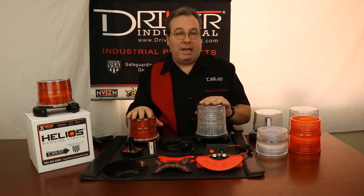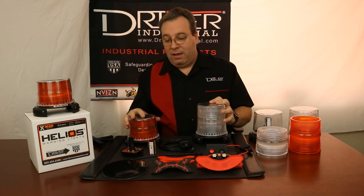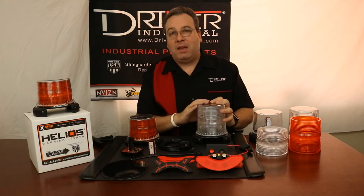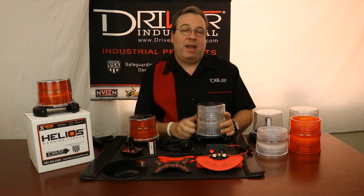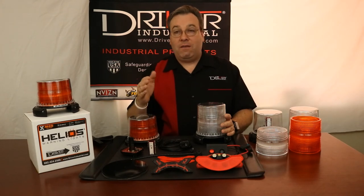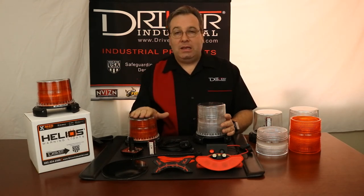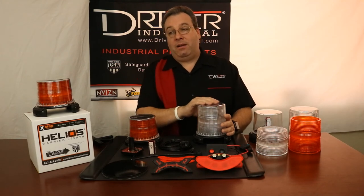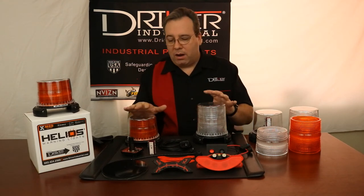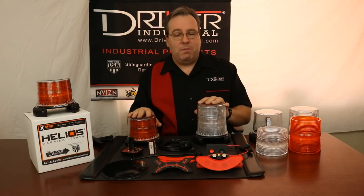If anything breaks or needs to be replaced, you can surely do that. If your job title or task changes and you need to switch something up, you don't have to throw your old beacon away and buy a brand new one at full price — you can buy just the parts you need to adapt it to the new job. These beacons are a Class 1 beacon. Whether you're looking for a Class 1, 2, or 3 beacon, these are Class 1 — the brightest output — and they'll meet the needs of any of those classes. We've also made it to meet the requirements of California Title 13 as well as SAE requirements.